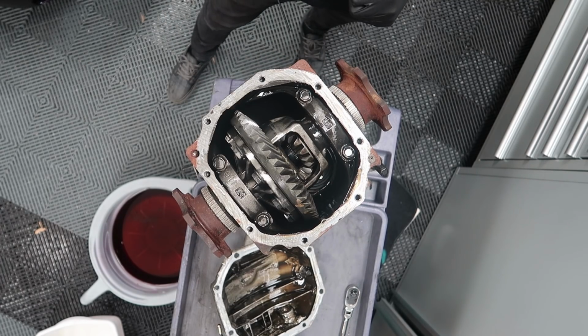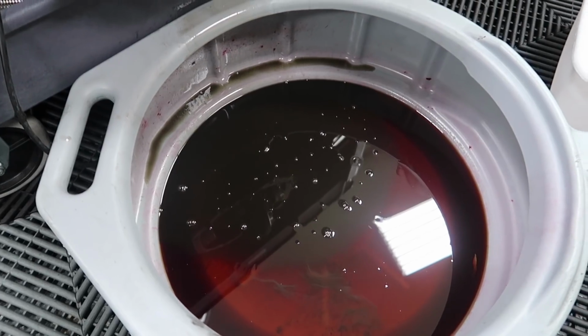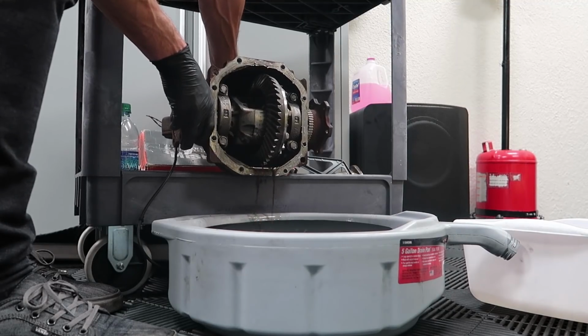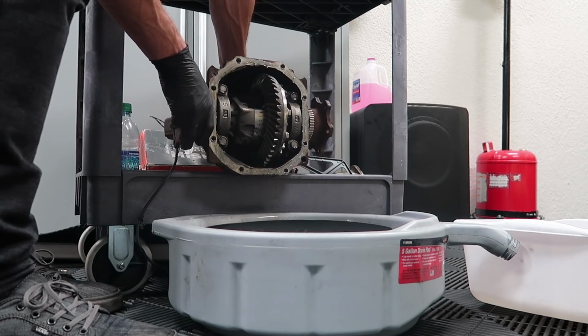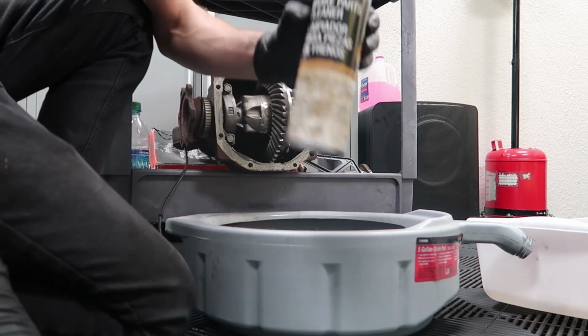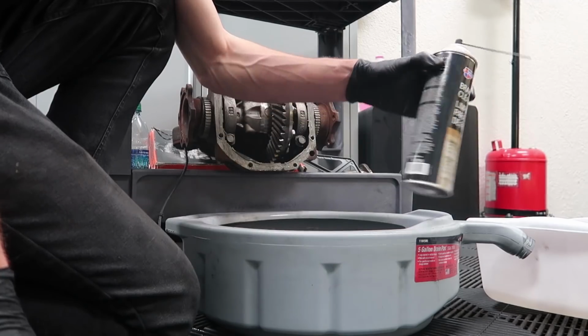Normally you have to brake clean it, and then you should be using acetone to clean the bubbles. And spray acetone everywhere. You can see now just all the crap that we got out just from one quick spray of brake clean, but I'm gonna be going over this for some time. Probably gonna need like 2 or 3 cans of brake cleaner to do this properly. Alberto and I both like using this stuff. It's pretty cheap. You can usually get it for like 2 for $4 or something like that.